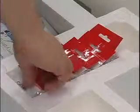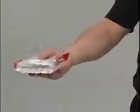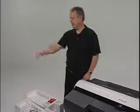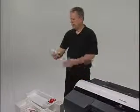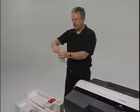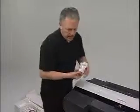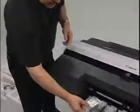Take each ink tank packet, one at a time, and gently agitate it from side to side 7 or 8 times by simply turning your wrist. Do not shake the ink tank aggressively. Shaking could cause the ink to sediment, which could affect printing quality. After gently agitating the cartridge, open the pouch and set the ink tank close to the printer. Continue to agitate and open each packet until all 12 ink tanks are ready to install.